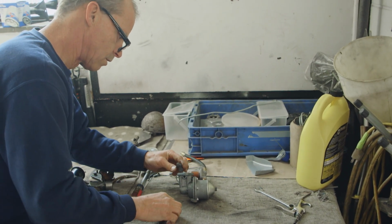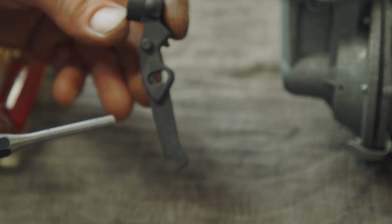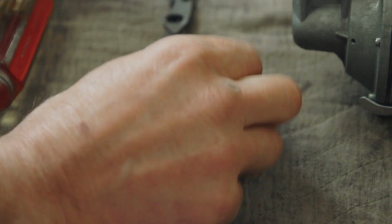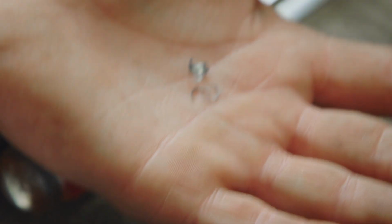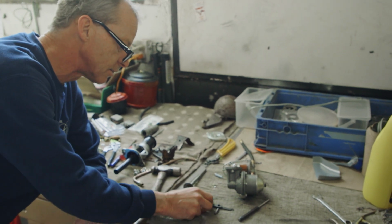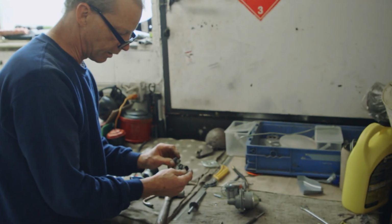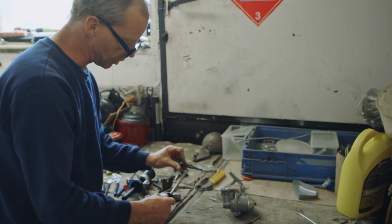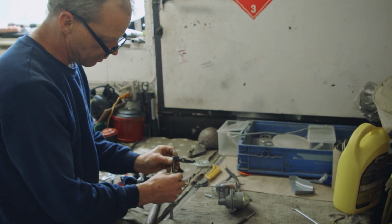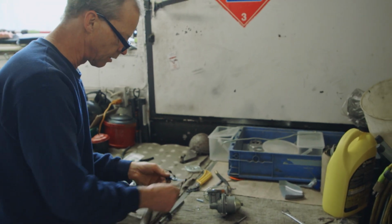Voila! Look inside, see? Little pieces. There's your bushing, what's left of it. So it looks like the bushing's whacked out of it. So the shaft might actually be the right size. So yeah, that'll take up that quarter inch. So if it's down tight on this shaft all the time, as soon as the shaft goes up, it should give it enough throw to make the pump work.